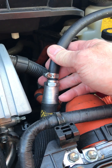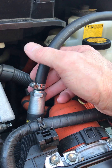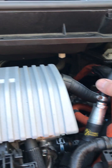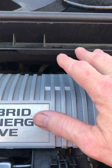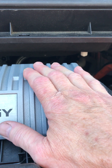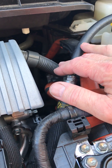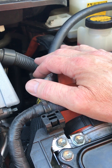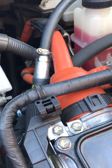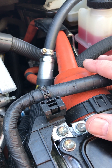If you've worked on these cars you'll know exactly what I'm talking about. Make yourself something like this to relocate the PCV valve so it's pointing in a more vertical direction — vertical being the key. On most older American-made cars you'll always see the PCV valve sitting on top, and that's for a specific reason: it allows blow-by to exit the engine without passing such a large quantity of oil. This basically puts it back to where it would be if it were designed more efficiently.